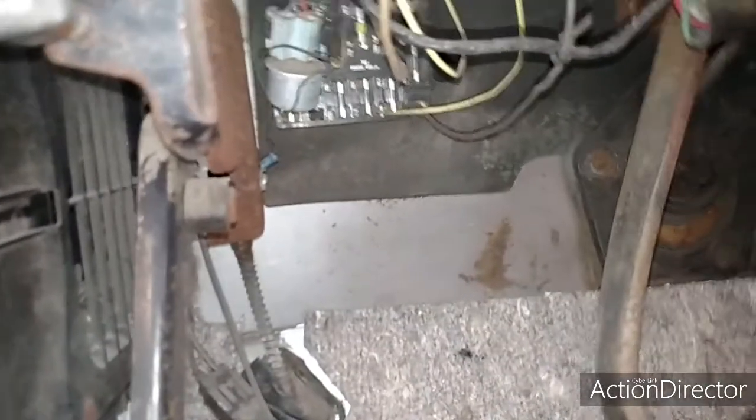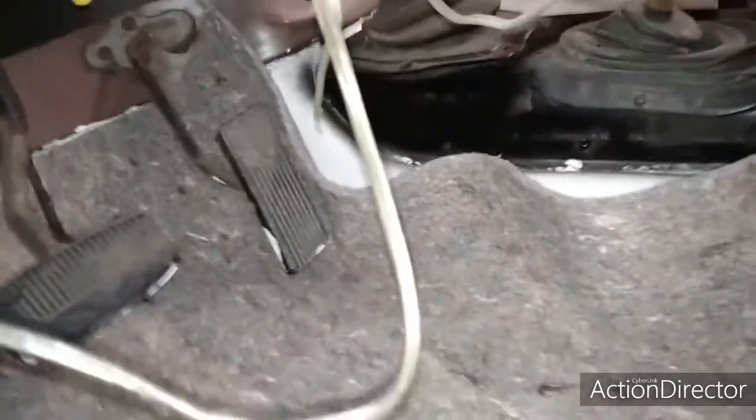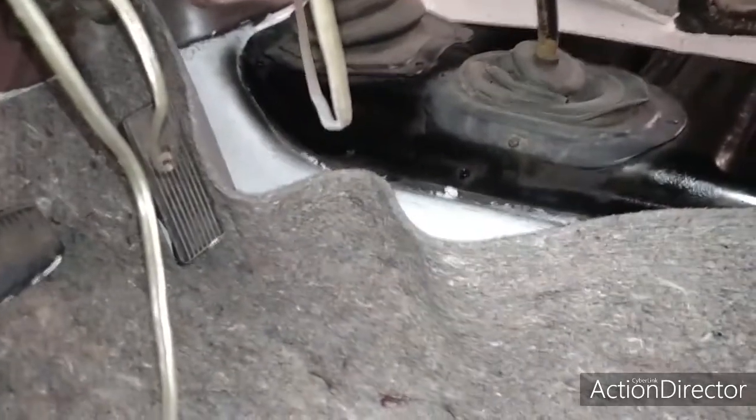So now I made a slit around that for the clutch pedal, cut a little bit out for the hole, and the emergency brake cable - I cut that out because that thing's broken and I might want to replace it someday, so I don't want it to be too hard to get out of there. This stuff here is all pretty flat, but when you get over to this other stuff we've got all these crinkles. So what I've got to do is make a bunch of little slash marks to pre-cut this. I wish I could show you but I don't have a cameraman.